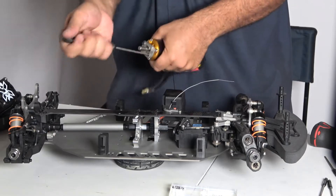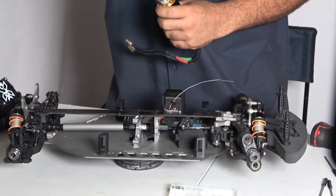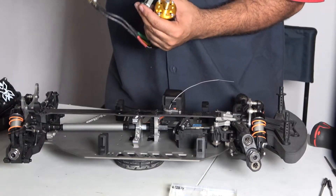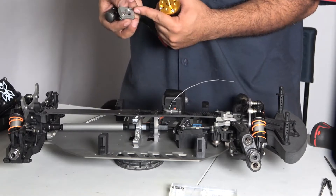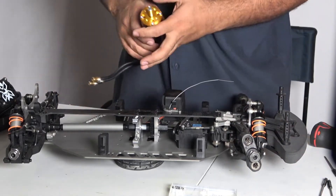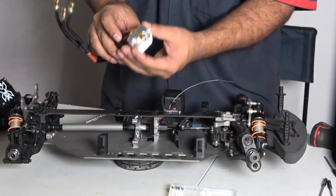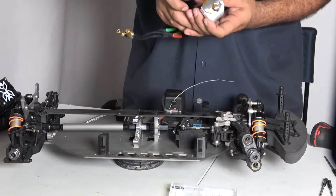The hard part is taking off this one because I put thread lock on these. The other problem with the motor mount design was I had to drill — I had to drill the hole, the outer diameter and the inner diameter — to fit the bolts onto this motor. That was another issue. But now we got this mount which you can put a big or small motor in — it's adjustable and can go to different positions.